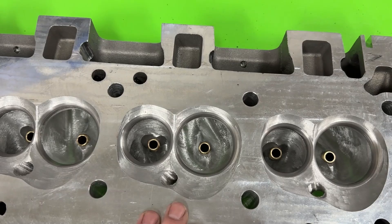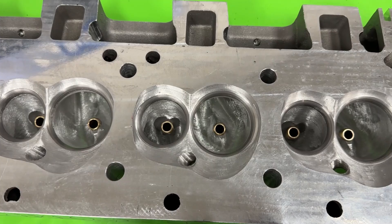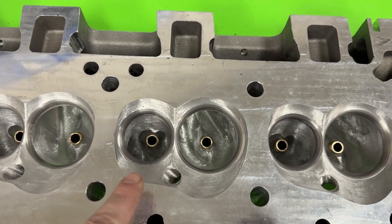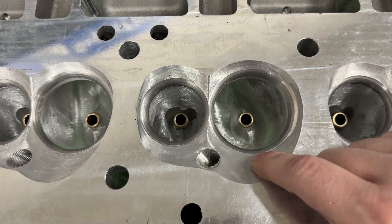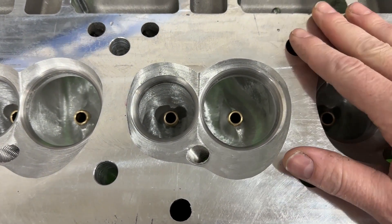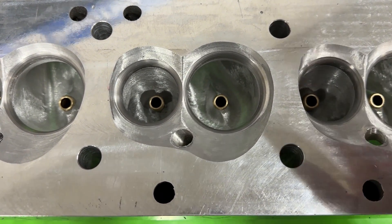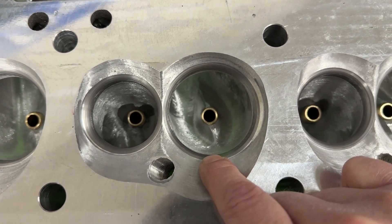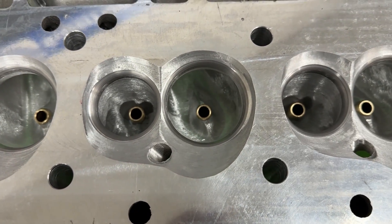It's a small bore, about the same size you'd have on a big block Chevy stock, and the Mopars. The difference is Mopars are in line too, but look at this comparison — dramatically better. This one actually has a 2.25 intake valve and a 1.800 exhaust valve. In truth, he can go with a larger intake valve, and I did some testing on that. Because on some of his stuff he's got bores that are 4.42, so it could take a bigger intake valve. The catch is his intake seat insert is a 2.28, so you can't even do a 2.30 — otherwise the seat's in the aluminum. That's a no bueno.